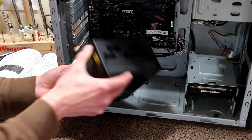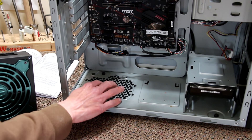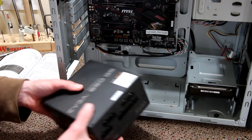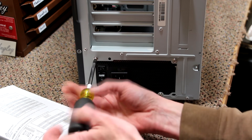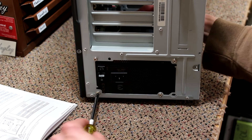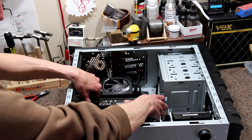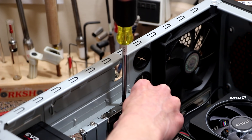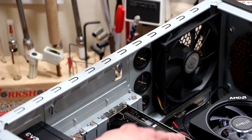Now I'm just going to install the power supply. This has the fan on the bottom — I believe you could mount it either way if you needed to. But my case has a vent on the bottom, and my intent is to put this up on a piece of wood so that you get good airflow, so I'm not worried about the fan drawing from the bottom. The power supply just gets secured with four screws from the back — really quick and simple. And now we can move on to get the graphics card installed. This is going to just pop down into the slots. You want to make sure that it seats fully. I always make sure to secure it with the screws — I don't want it to just flop around inside the case.